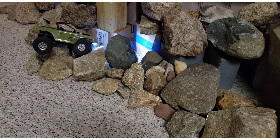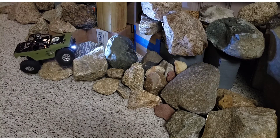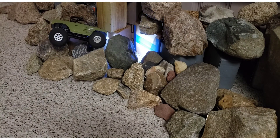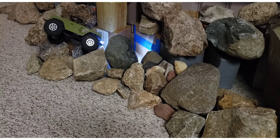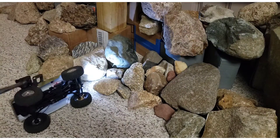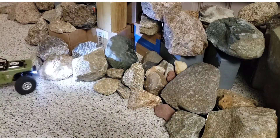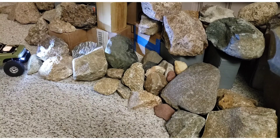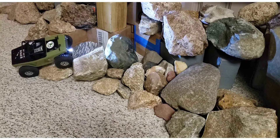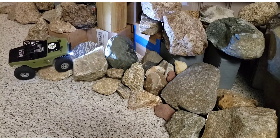I want the front to dominate what the truck does. I just want the back end to follow and do what the front tells it — otherwise you've got to drive the front end back half of the car, and that's fine for four-wheel steer but this is only two. I'm running into an issue where my steering servo does not have enough torque. When I throw the wheel to one side or the other, I need that wheel to move, and with this big of a tire plus the weight behind it, the servo just can't manage it.